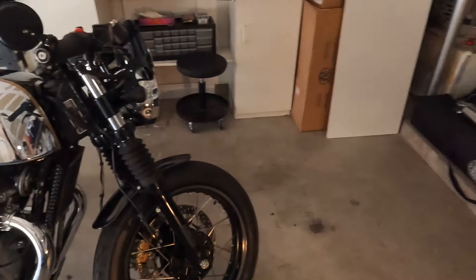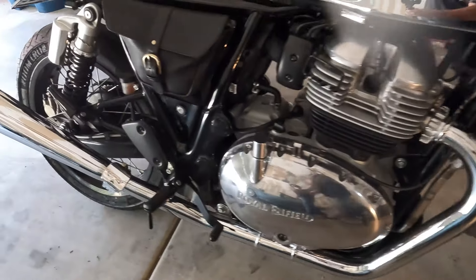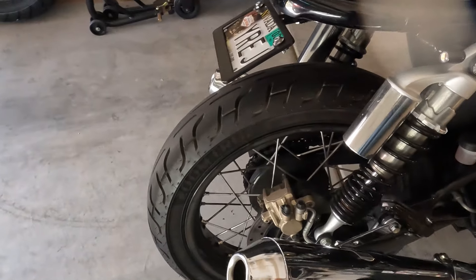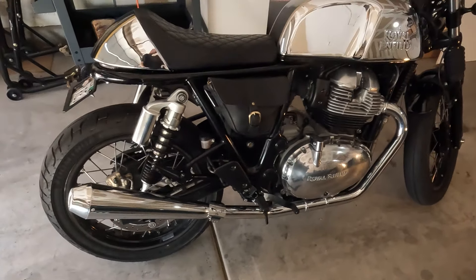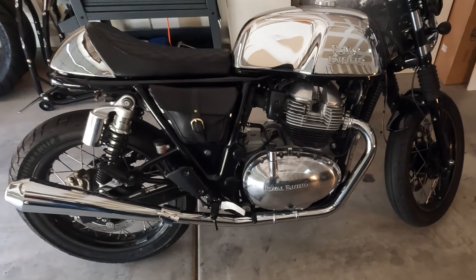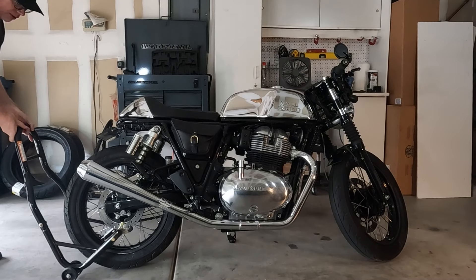The first thing I need to do is take off the front tire, take off the rear tire, then remove the tire from the rim and do the tubeless conversion and seal up the rims. I'll lift the back first.